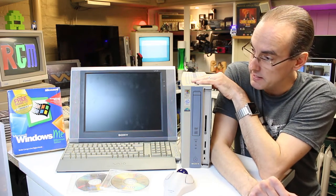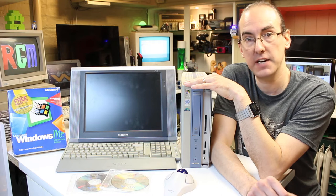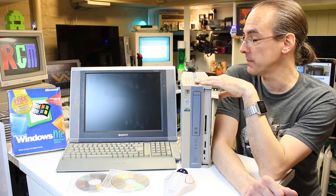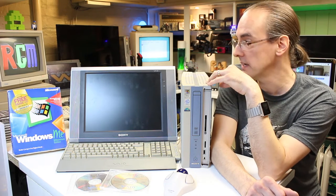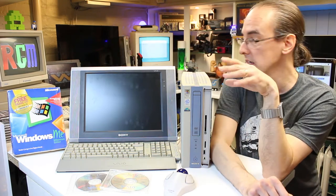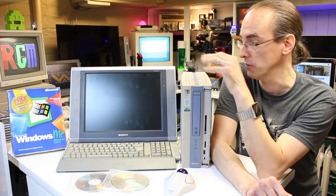I gave up at that point because I thought I'd never get a matching monitor - on the monitor itself it has the PS2 mouse and keyboard ports which you need to carry on setting it up. There's a proprietary connector from the monitor to the base unit that carries the picture and sound, because it's got its own two built-in speakers. And back from the monitor via the same cable, the PS2 mouse ports carry the signals from the mouse and keyboard back to the main unit.